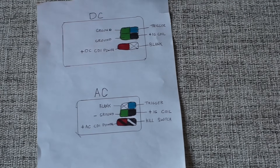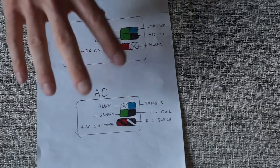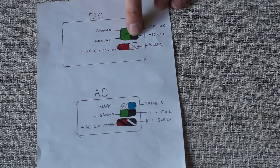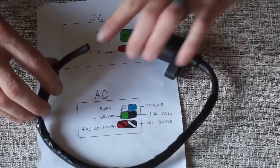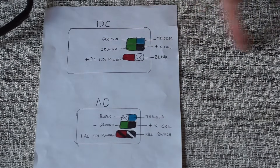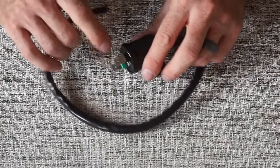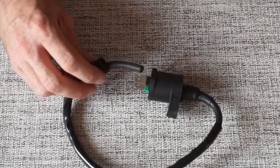The CDI box then does its little calculations to figure out what the timing is going to be — it's all pre-installed into the CDI unit, kind of like a little miniature computer. And then once it figures that out, it spits out current to your ignition coil. This is where your spark plug plugs in. The spark plug cap isn't on this ignition coil, but this black wire is how it sends a signal out — going into this black lead right here — and this thing builds up a bunch of juice and sparks the spark plug.